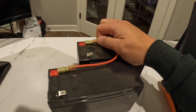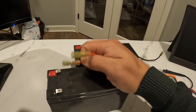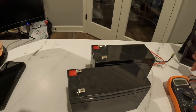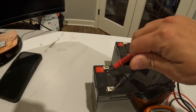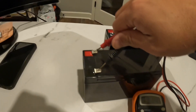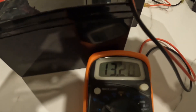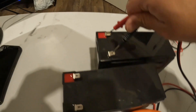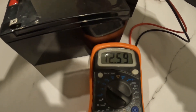Take that one out, take the positive and positive out. Now if I bring the meter out — it's hard to do one-handed — but this one used to be a bad battery and now it's reading 13.20. Now let's see this one — same thing, boom. This one is not quite there yet but you can now actually charge it.